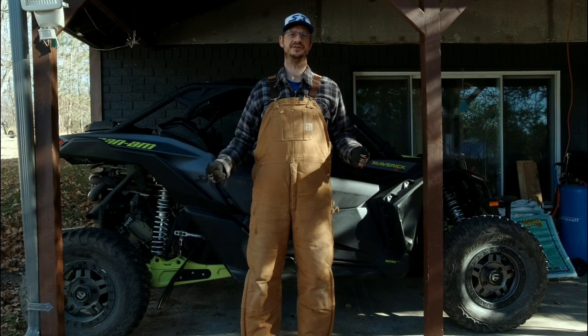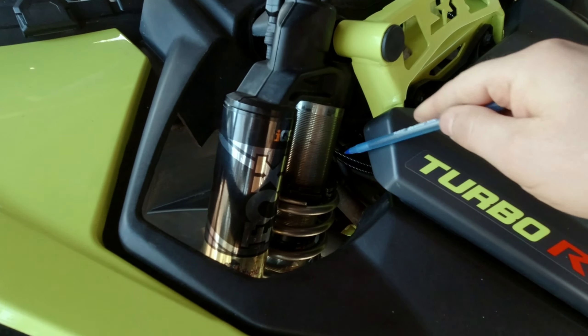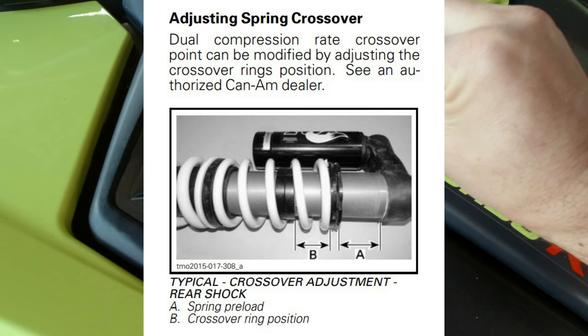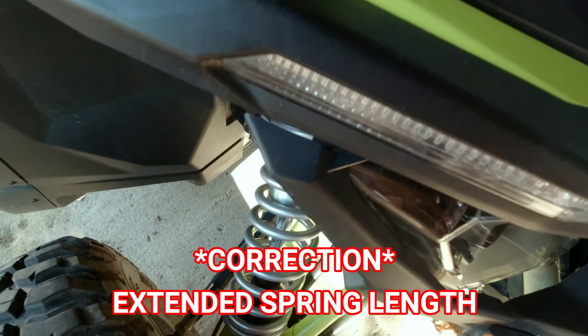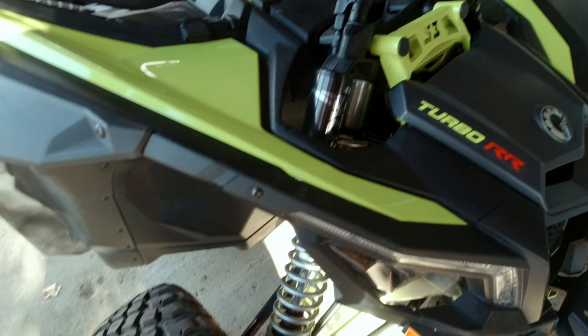If you are tuning your factory stock suspension from the manual, they're going to have some different procedures. They'll have you measure things like from the top of the preload collar up at the top of the shock body, and other things like fully extended shock length with the car jacked up off the ground. For our procedure today that's completely irrelevant — we're going to do what we have to do to get the proper ride height set, which is 15 inches in the rear and 15 and a half inches on the front with 30-inch tires.